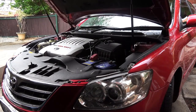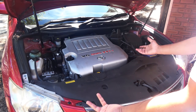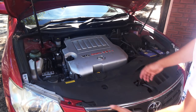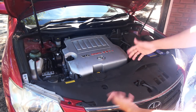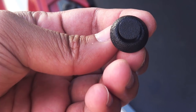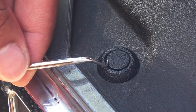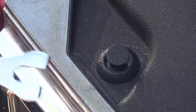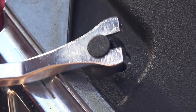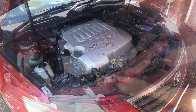The first thing you want to do is open the hood and locate the alternator and the battery. Most modern cars come with plastic covers installed over the engine compartment, which look nice but are annoying for maintenance. These plastic covers are held by little panel clips — get a small steel pick under the head and pull, and the clip will pop right off. After removing all the clips the cover comes right out.